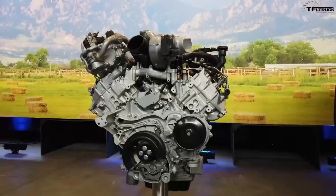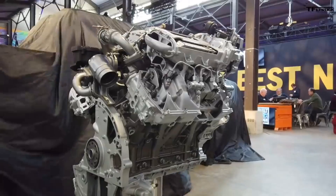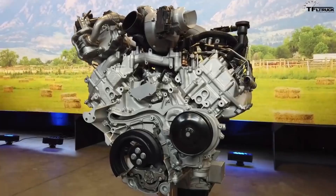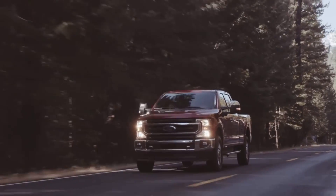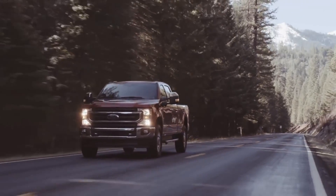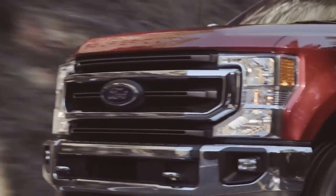After the fuel system, we go down to the cylinder heads. The cylinder heads are completely different — it's a brand new cylinder head. In my opinion, cylinder heads are 80% of an engine; put a good cylinder head on versus a crappy one and you'll see tremendous differences. Everything about the top end of this engine has changed. Moving on — the cam. I'm 90% sure they didn't officially mention anything about the cam, but you have to change the cam to match everything else. It's got to work together in an orchestra-type fashion, and the cam plays a big part in delivering smooth, continuous power.